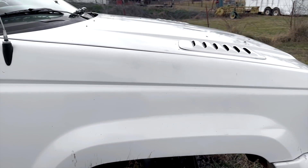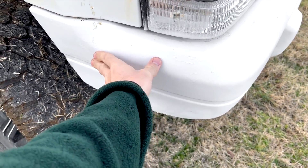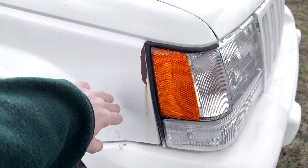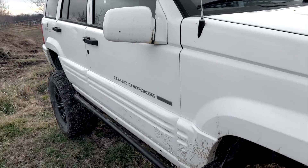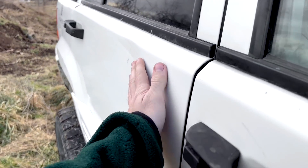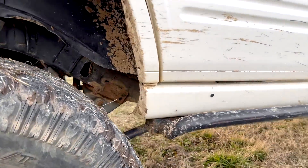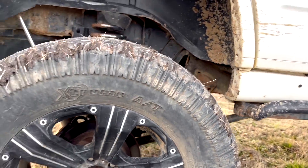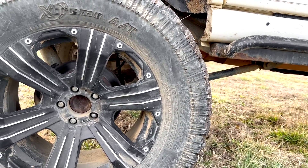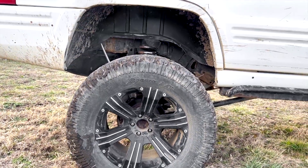The body's okay. We've got the 5.9 vents which are painted the same color as the front bumper, which isn't the factory color the body is. We've got a little bit of rust and some dents just from some damage. There's a few dents here, and we've got some sliders on it — those are nice, those are welded on. We've got 18s — these are 325/60/18s, so it comes out to be like a 33.2 by 12.9 or so.